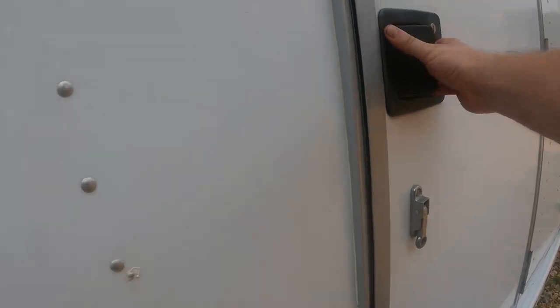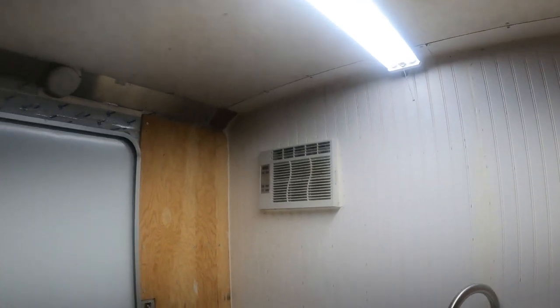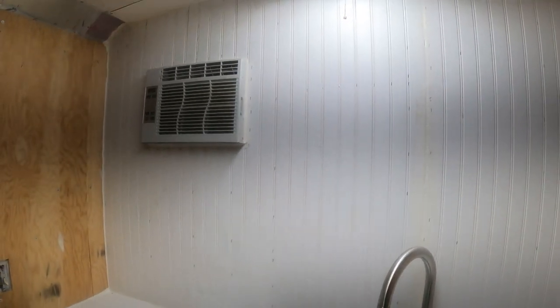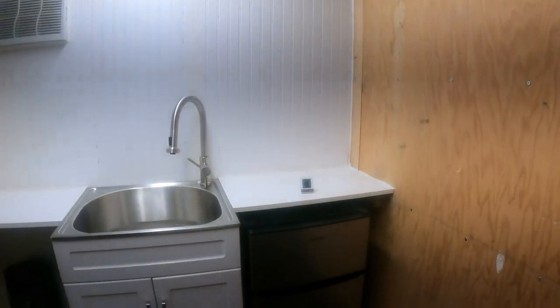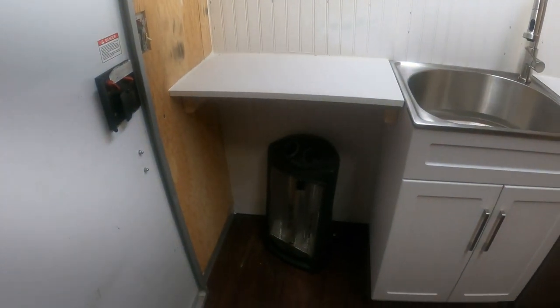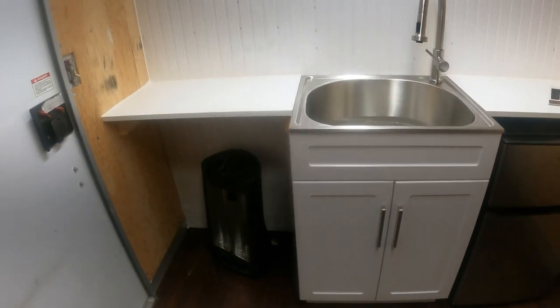Now I'm going to enter the living space. Once I fired the generator up, the air conditioner automatically kicked on. There's a little LED light up there — plenty for this area. There's about 48 square feet of floor space. This 5,000 BTU air conditioner draws about 400 watts when running, so it's not much of a load on the Honda. The fridge only draws about 50 watts when running, with about a 400-watt start-up. We've also tested a little space heater — at 750 or 1,500 watts you could run it off the Honda, it just wouldn't be as efficient.